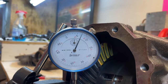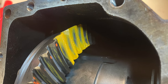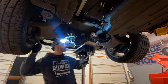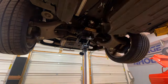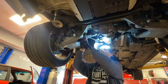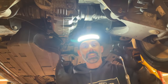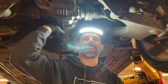The backlash was within spec, the gear mesh was really good — nice and centered — and the heel and toe wasn't too far in or out. We reinstalled the rear cover and put the whole thing back together. It really wasn't that difficult, lots of bolts, everything torqued, and installation was pretty simple. The differential is now completely installed — we've got a 3.46 limited slip in the rear.